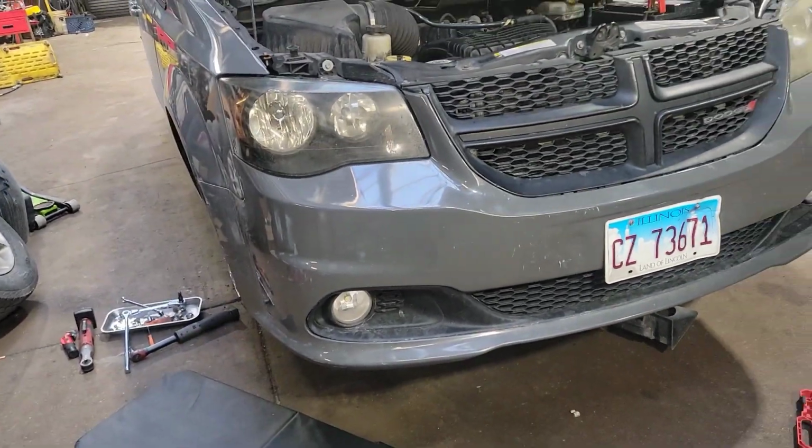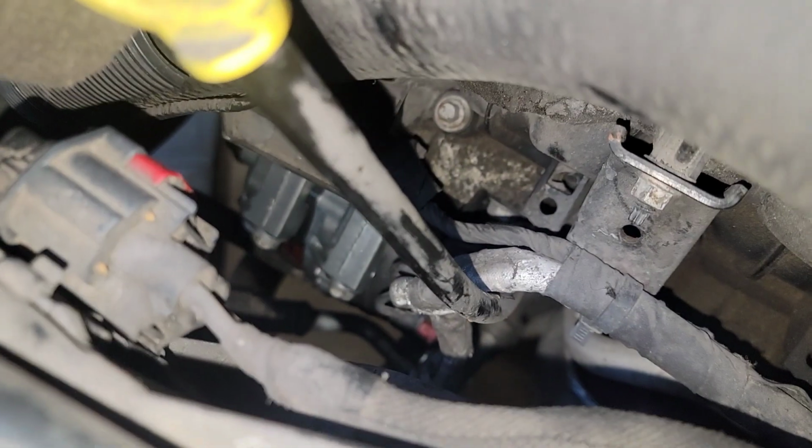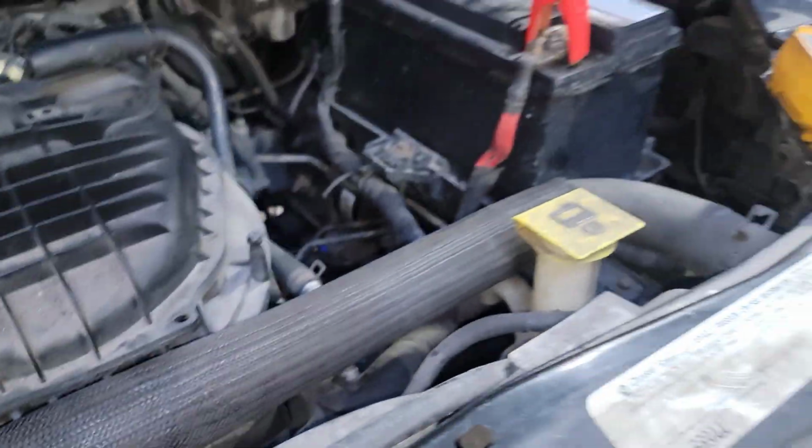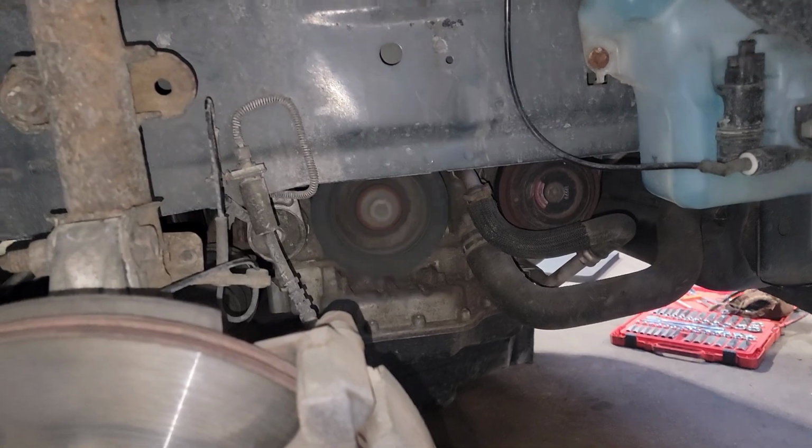something. After looking at it and diagnosing it, here helping out at the shop, I got Eddie down inside this thing and had him put a new alternator down in there. And now it no longer is doing what it was doing before. And the sound was rock in the flywheel. So that alternator was grounded out so bad, or internally shorted, that with the power lead being hooked up to it, it was literally just frying those cables, just glowing.